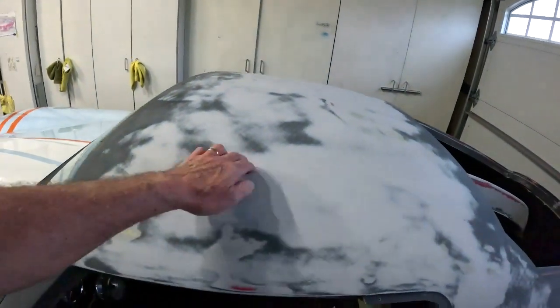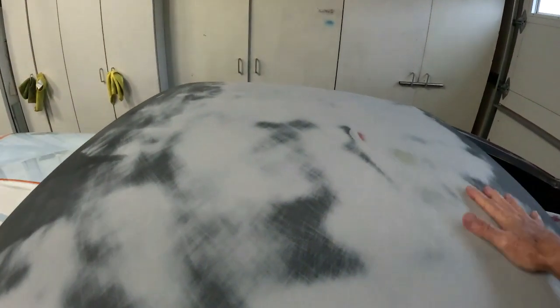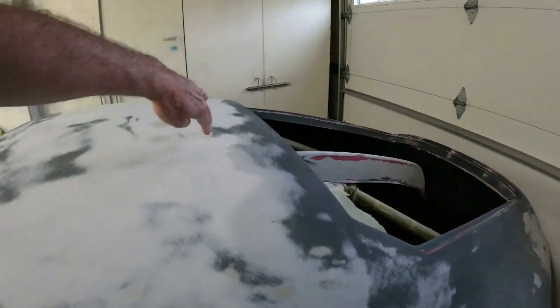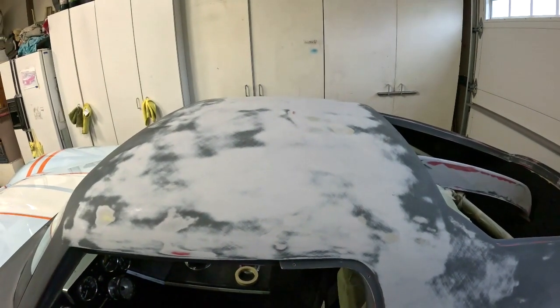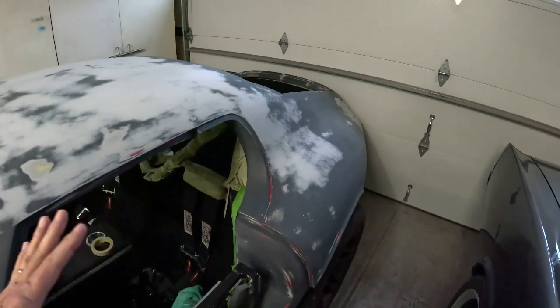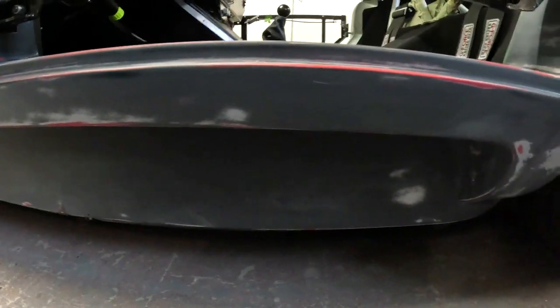When you block off primer there's not much left — you can see two good coats were rolled on and a good chunk came off to make sure it's totally square. This area back here was a mess — the Factory Five roof area had a mold seam, it was just a mess — but now it is perfect. One quick coat of primer, block that out, and it's ready for paint. The sides are all pretty good too; the big pain was sanding all up in here, but it's all blocked out really well.